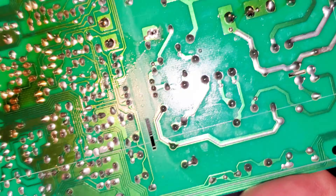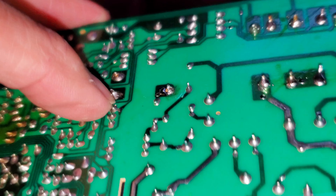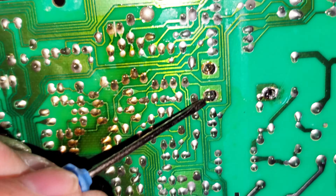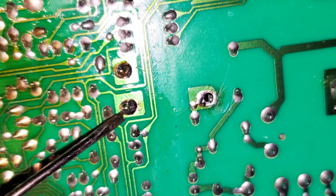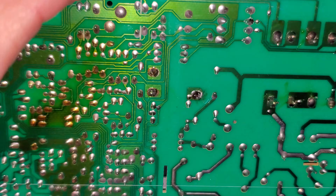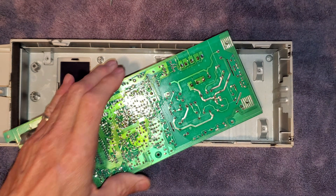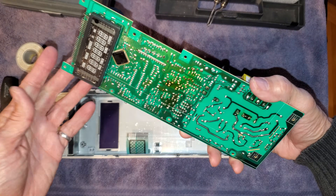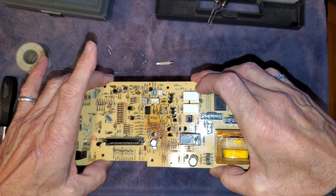You can see all these little solder joints — sometimes they come loose. There's the main relay. These two on the left look a bit burnt but still okay. But you can see this one has lost its connection. I'm glad I found it — that's definitely our problem. You can see all the burn marks. These get a lot of abuse: a lot of heat exposure, a lot of current going through that relay, and it sits above cooking food every day.